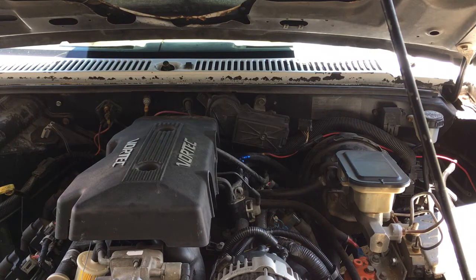I am out working again, just step-by-step diagnosing what's going on with these windshield wipers and why they quit working. Just a quick follow-up on what we'd found previously: we felt like there was some kind of an internal short, either in the electronic circuit board inside the motor, or possibly the motor itself just died and got internally shorted. We did verify that the internal switch on the column is working properly, properly sending the signal and the power to the main harness, to the actual windshield wiper motor.